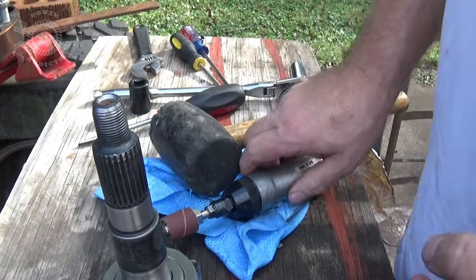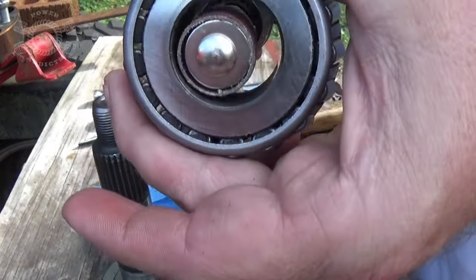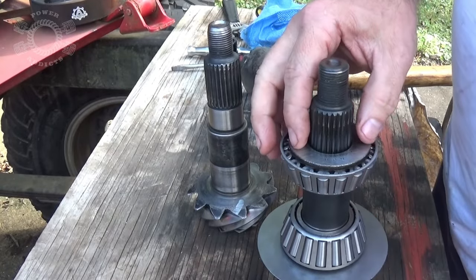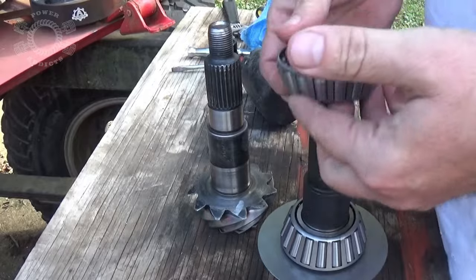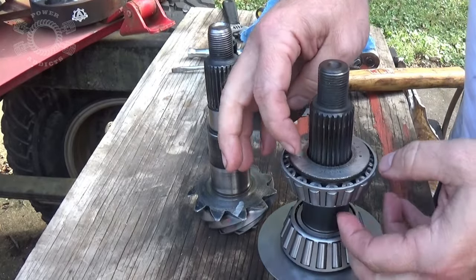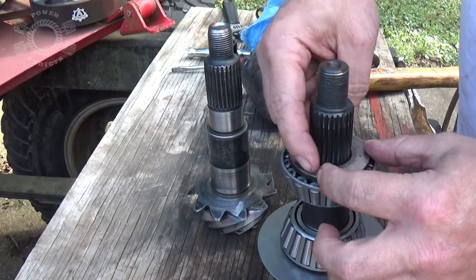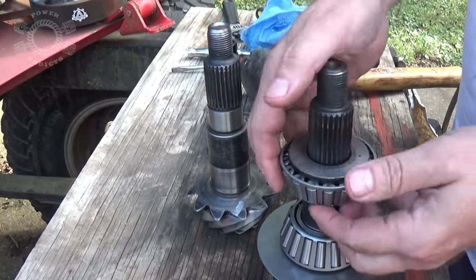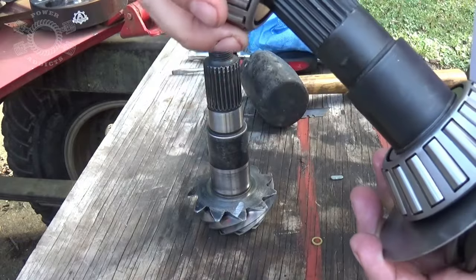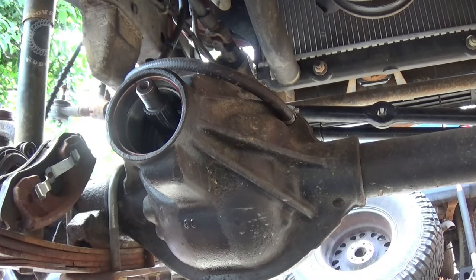So I'm not going to put you guys through all the racket of this thing, but I'm just going to open this up a little bit until it slides good on that and I'll show you the fit when I'm done. See it won't fall down on its own but if I take just subtle pressure it slides right down - pull it back off, comes right off. Each way it takes just a subtle little bit of pressure and that's what you want, because then you've got zero or extremely little clearance between your bearing and the bearing surface. So now that makes the setup so much easier. Be sure to clean the bearing good before you start using it - you don't want that junk inside your new clean differential.